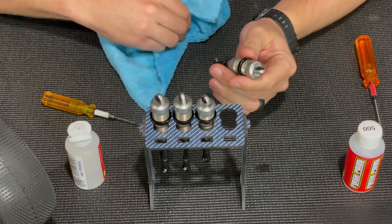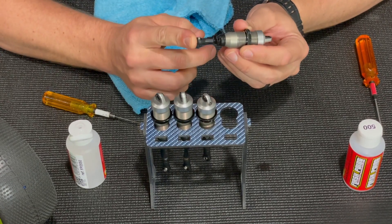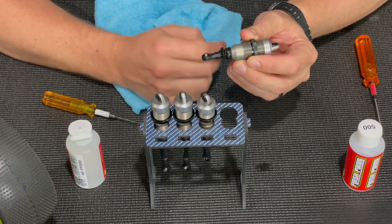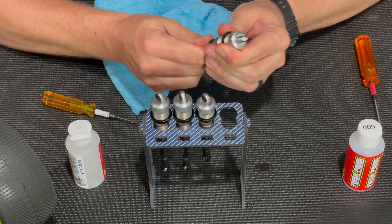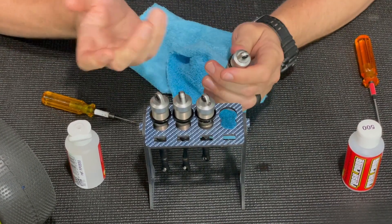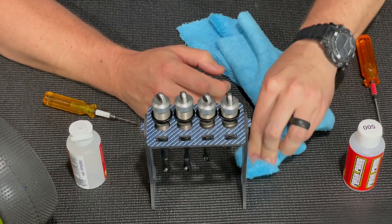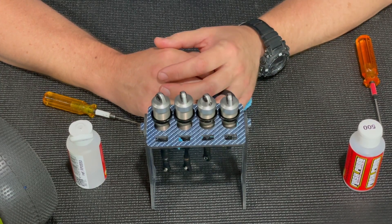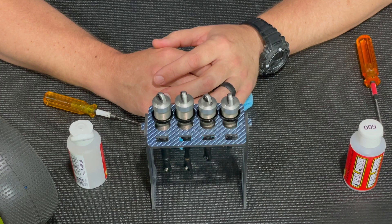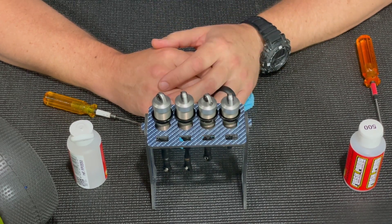You'll want to check the shock by pumping it a few times and making sure there's no rebound. You may see just a couple millimeters of movement but that's just because of the shock boot. You can do it with the shock boot off if you want — usually I'll bleed them with the boot on. Pump it a couple times, make sure there's no rebound, wipe off any excess oil, then move on to the remaining three shocks. It's pretty simple. It's a little bit messier than with a bladder but the performance works really good. I'll do other videos in the future doing a comparison between bladder and emulsion, and also a video on the Mugen emulsion caps that will soon be released.